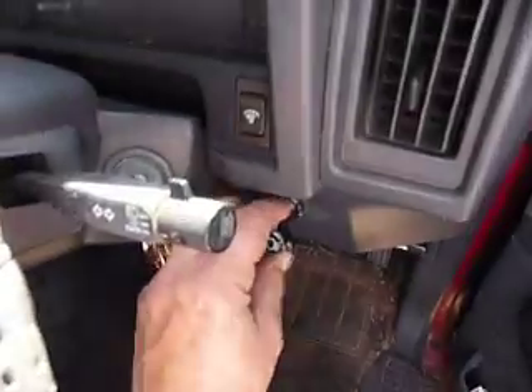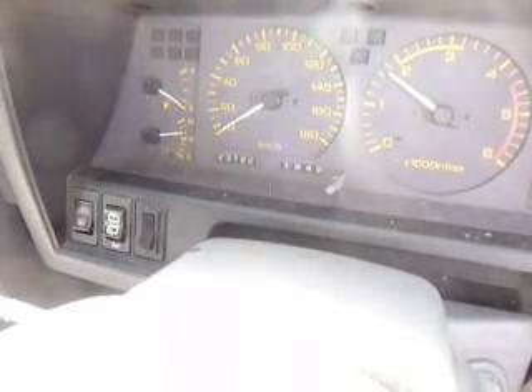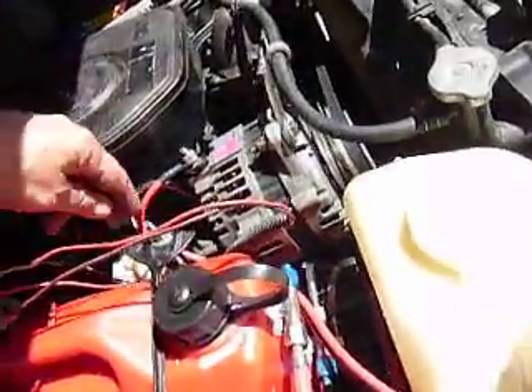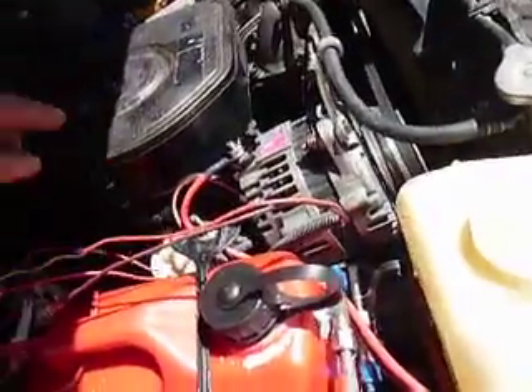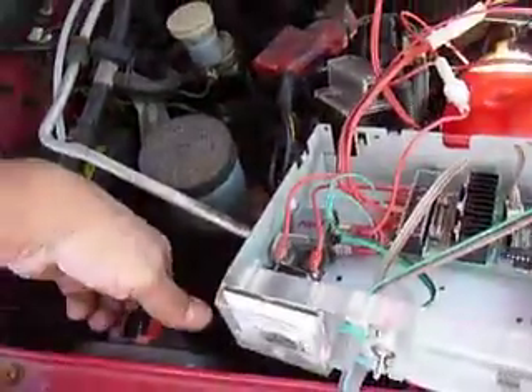Let's just start the car up. The car is already warm, so let's just run the motor around 2000 RPM. The car is still 12 volts controlling the field, and this is all 12 volts from the car. The output is going directly to the cells, which will end up having a shunt on the earth return going back to the box with the eBay meters inside the car. I've got a battery isolator here and an ignition sensor line with a relay.